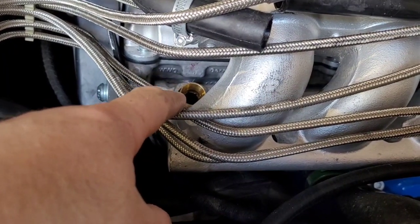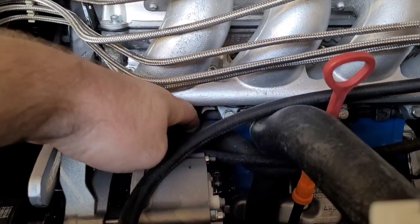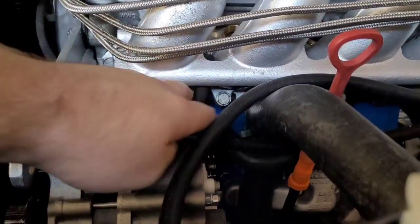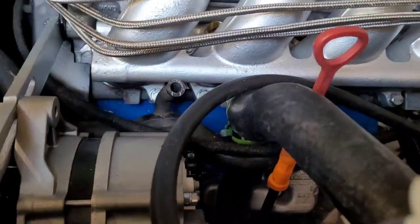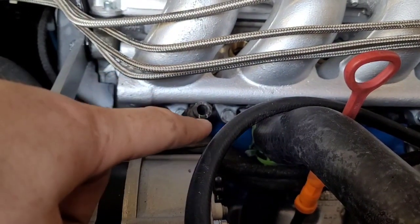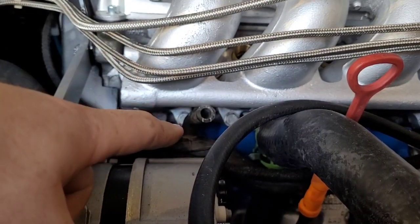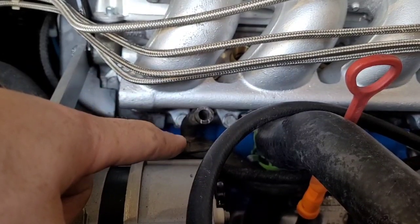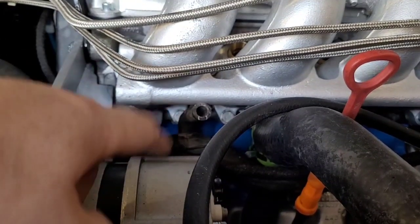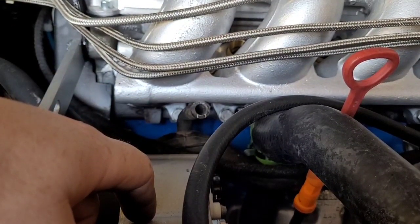All I have to do is fit the normal injectors. You've got the normal top seal, but there's no bottom seal to worry about. There's this T-piece that goes up the inlet manifold - pull it off. That's the bit that goes on a nipple on the inlet manifold, and that's the part which brings the air across for the air shrouding. All I'm going to do is cut that in half, put a solid tube inside of it, put it back on, and glue the pipe together - so it will look normal but it will be blocked up. No air can be drawn in from either side.